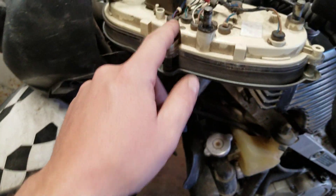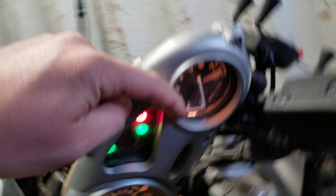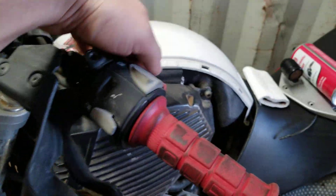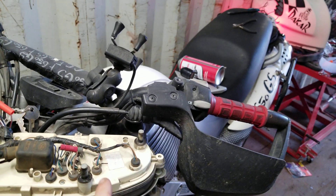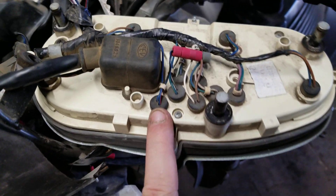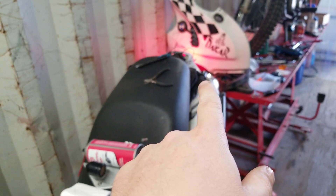Anyway, here's the problem. It's the winker light. So up on the dash, when you flip the turn signal on, that comes on there. This is the problem right here — it's grounding both directions through the winker bulb, just because of the way that they wire it, because now your turn signals only work one way.